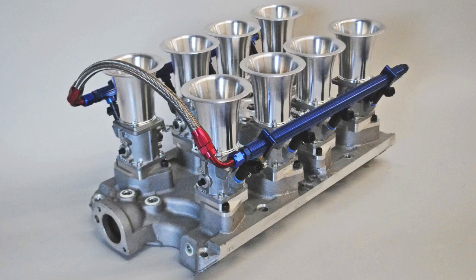The next thing is to think about performance. This goes back to testing I did long ago, and it applies really more to the 302-based version than to the 351. On the 302 intake manifold, the round opening going to the square head port — the transition and the turn and all that — there's some room for improvement.